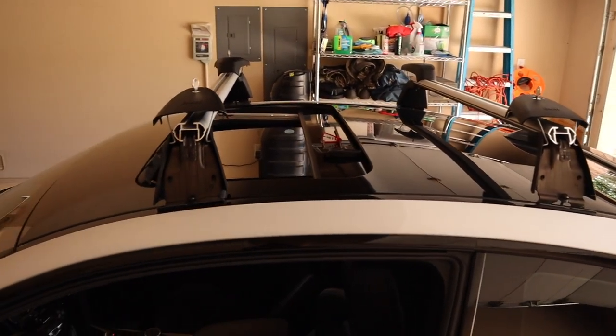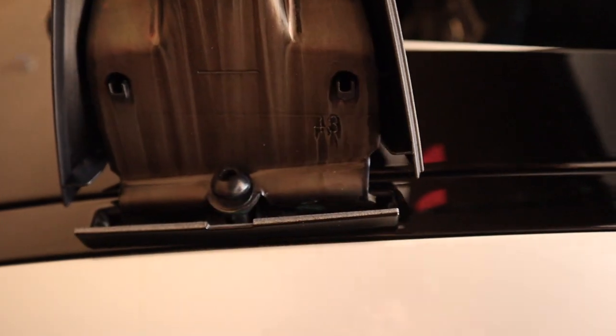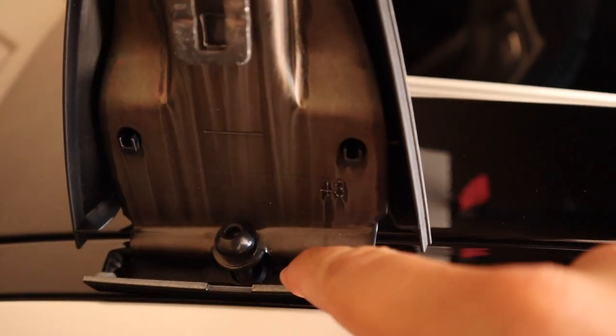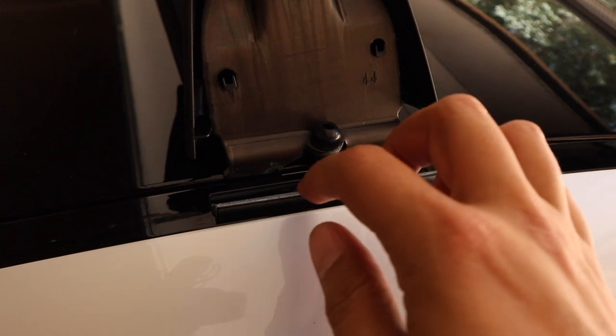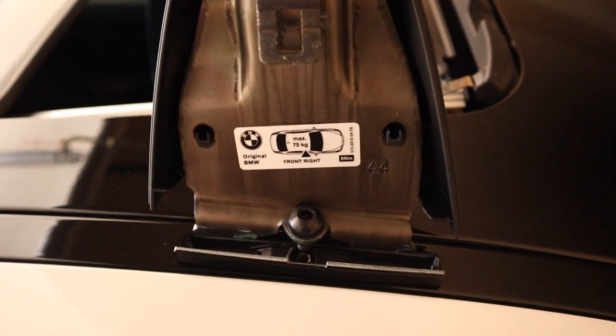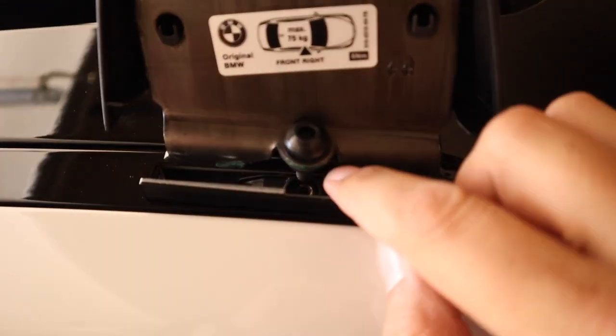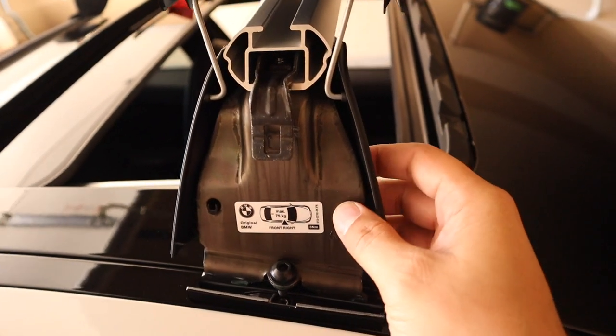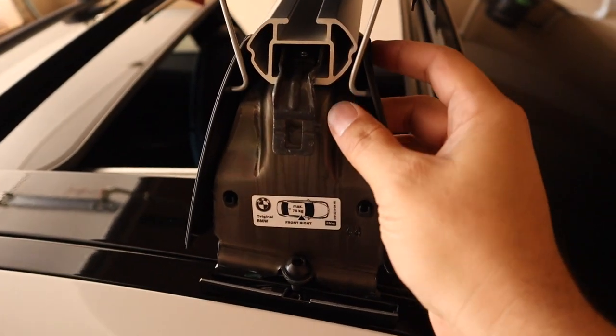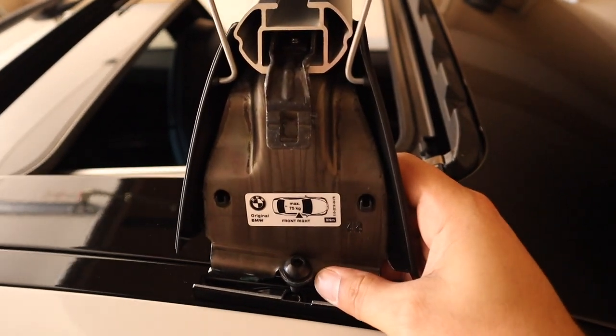At this stage, this is what your crossbars should look like on the roof. You should have them at least roughly lined up with the mounting points in all four corners. This screw here is actually perfectly aligned with the mounting hole. I suggest getting one side aligned pretty well, because we're going to have to make some adjustments. If we look at the passenger side of the front crossbar, this doesn't quite line up right — but that's okay, because there is some adjustment available. We have to pull this foot out a little bit closer to get it perfectly lined up.